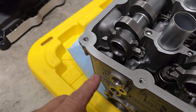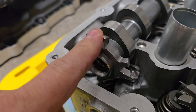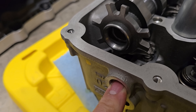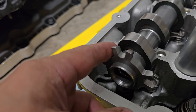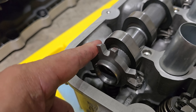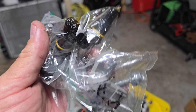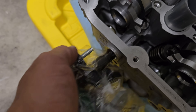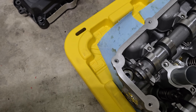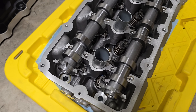For those of you wondering what the Hall Effect sensors pick up — they pick up these little teeth right here. This is what tells the computer what cam position you have. It goes around, hits on a little magnet, and that magnet reports back to the computer what's happening. These guys at the back of your cylinder head are called Hall Effect sensors — they have magnets on them and they pick up the cam position, reporting to the computer the cam angle.